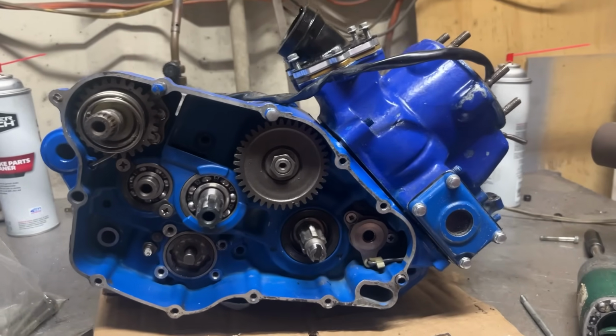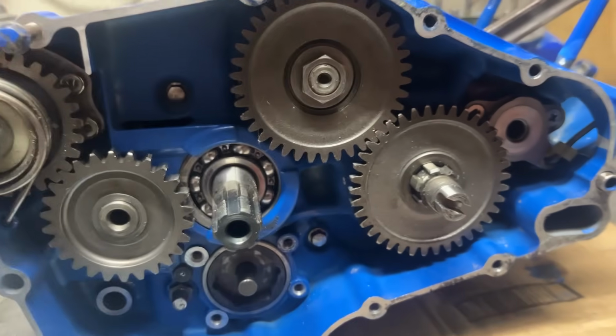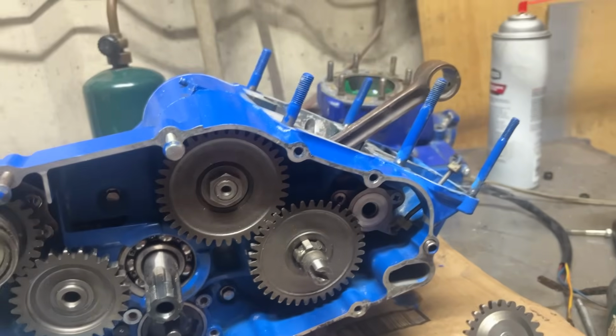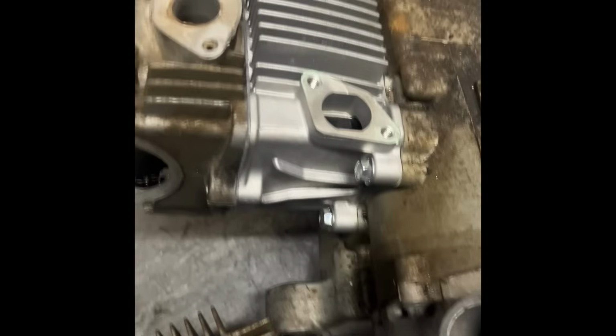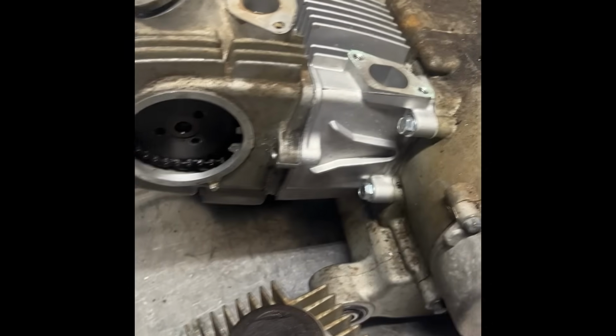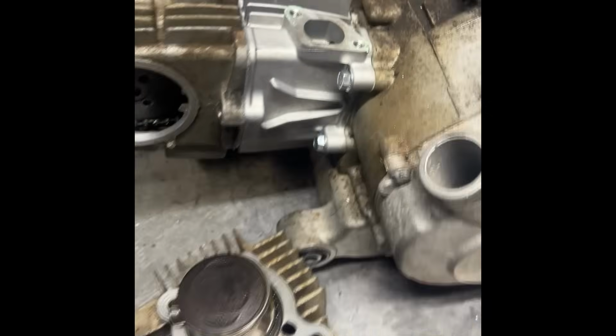We're having a field day this week. We got a quad racer engine that's going together. We're going to be trying to put that in the roller that we've got. This is for the 92 quad racer that we're building, my personal build. We've got a DS90. The Chinese kit cylinder is 4 mil too long. We've got to put it in the lathe and cut it down, make it fit so we can get this motor in the quad and out the door.